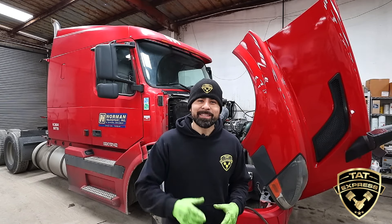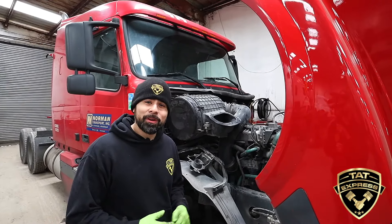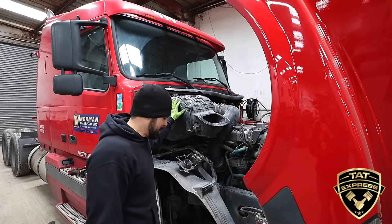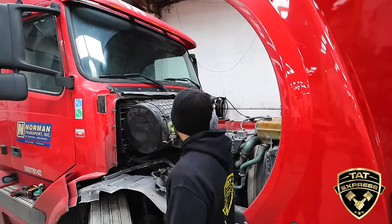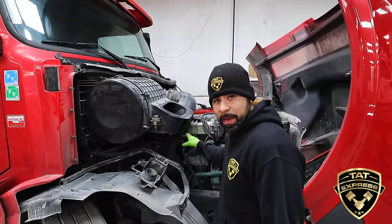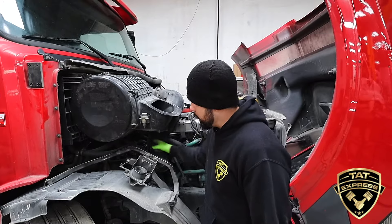So we're gonna get into that next. The first item we're gonna be doing is the boost pressure test. I'm gonna show you what needs to be taken off so we can do this test. The first thing that needs to come off is this air filter. I've already removed the clamps from the turbo and unbolted up top, and also the air intake for the compressor. On the newer models, they're gonna be on the back side.